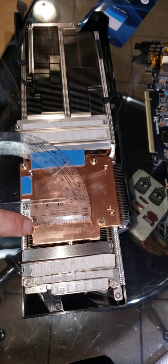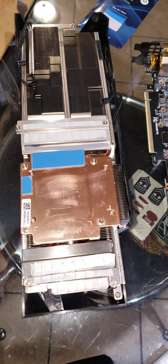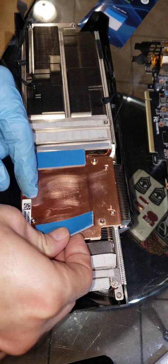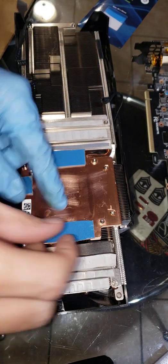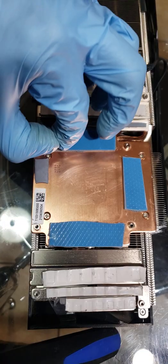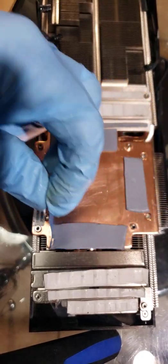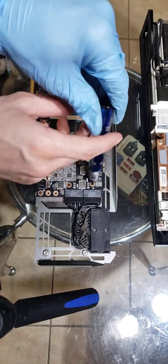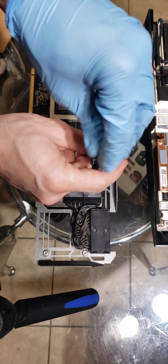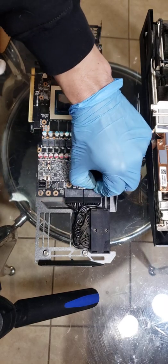Take notice — this copper plate has markings on it as to where these pads go exactly, and it makes it easy for you to measure it out. I'm also going to add a couple of additional pads behind this board, behind the CPU.